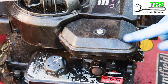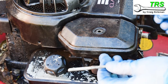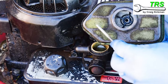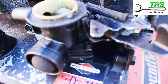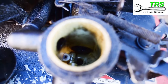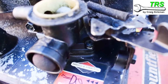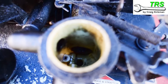First I remove the air box by using a flat-headed screwdriver to remove the centre screw. Because this is the only thing that holds the air box on, it can be lifted off completely after it's removed, and you can see inside there we've got the sponge of the filter. Removing this has now made it so much easier to look around and see what we're doing. Whilst we're at this point it's good to take a really close look and see if there's anything obviously broken or missing — any cracks or breaks in the plastic of the carburetor, or any metal obviously bent or broken.